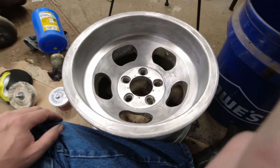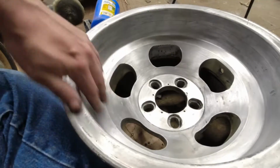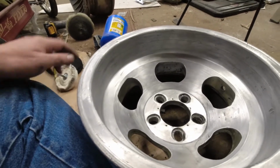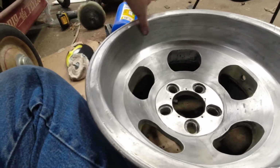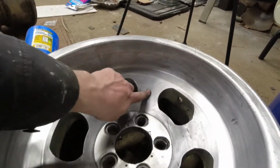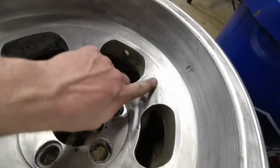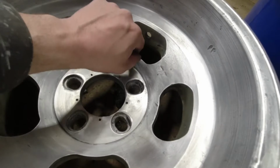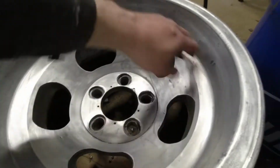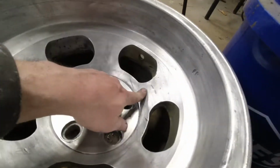Okay, day 3. I thought it had recorded the previous bit, but it didn't. We are now working with sandpaper to try and get a more consistent pattern. The whole thing's been gone over with 600 grit, and as it turns out, there are deeper grain scratches in it than I had anticipated. The lighter stuff is what's been sanded, the darker stuff is what hasn't been. So this whole thing clearly had a graining to it that I mucked with in many places while I was grinding, that was not visible before.